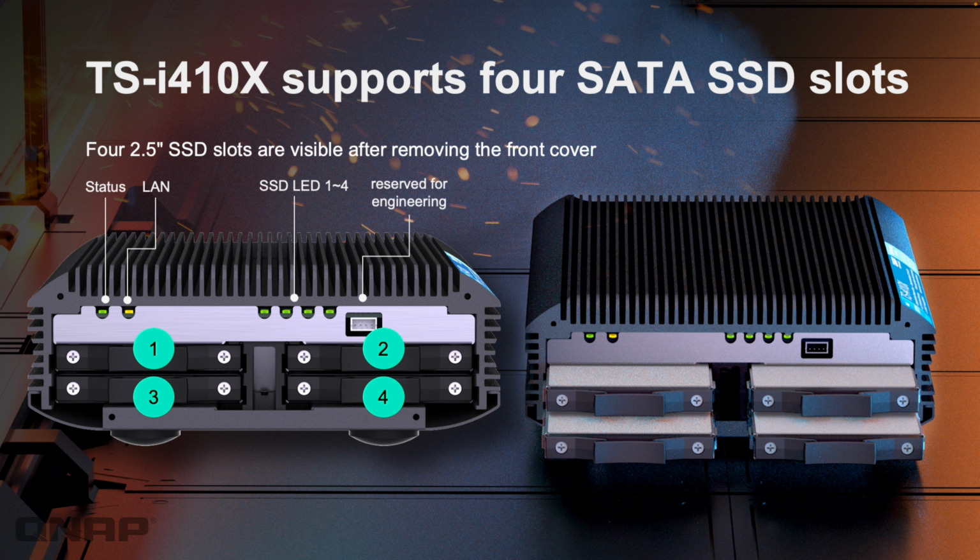It does support 4 SATA SSDs, so to get to those, there's effectively 4 thumb screws on the front of the device. That removes the metal front panel that has a small gasket around it, and the trays just slide out. They're not clipped in place, they're held in place with a sort of spring handle on the front when you screw the front plate on. So that's what keeps them inside the device itself.